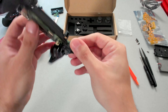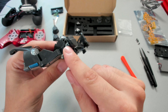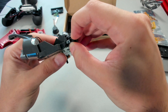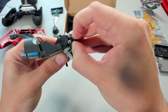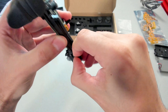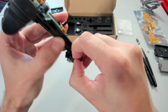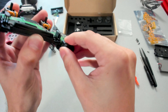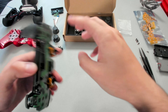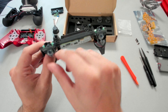To remove the bumper, I'm going to orientate this so you can see. I'm going to press it down — there is a little hook right there. I'm just going to pull down just to get the hook around and up and over the clip. Do the same on the other side. With this, guys, just take your time. Slowly, slowly, the bumper will come off. I'm going to do the same on the other side.